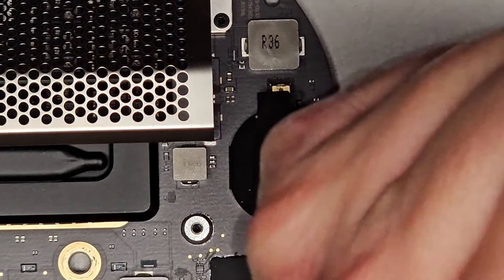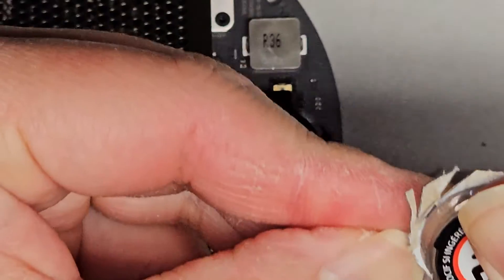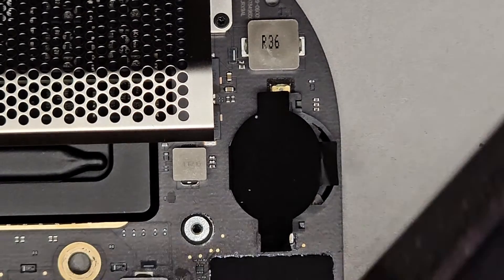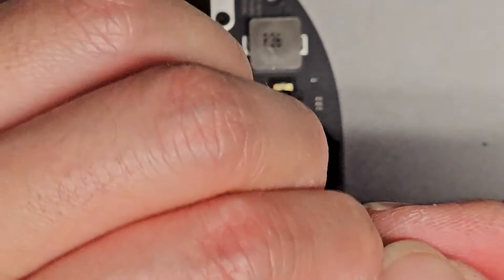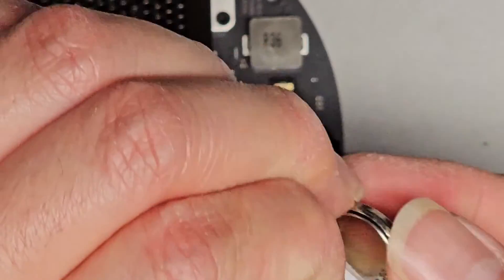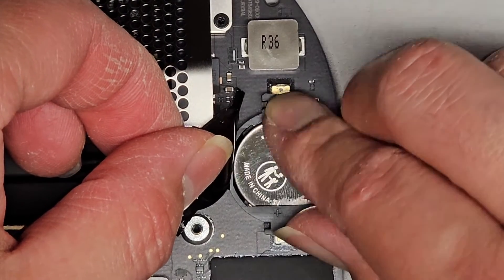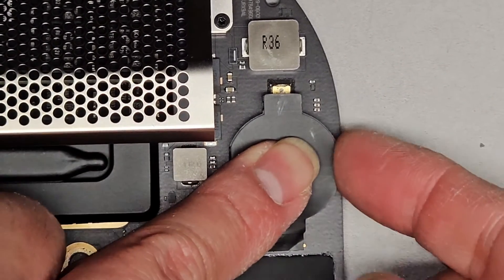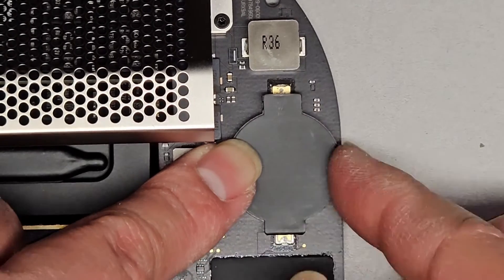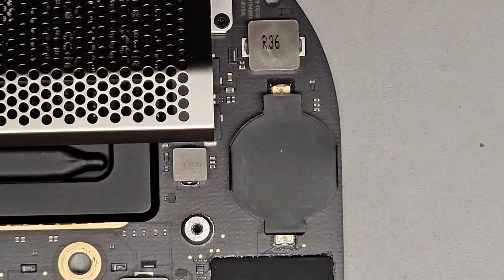I've cut up the plastic packaging. Now we can get access to this battery. There's a little sticker on this one — make sure you peel that off. Make sure you put it in the same way: it goes in like that and you push it down. It's spring-loaded — click that in. Very simple. Then swing that back over, tape that side down, tape the other side down, and push that. That's pretty much it. That's how you install the new BR2032 or CR2032 battery.